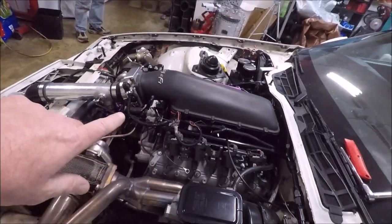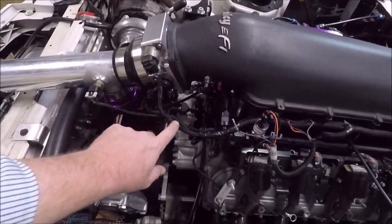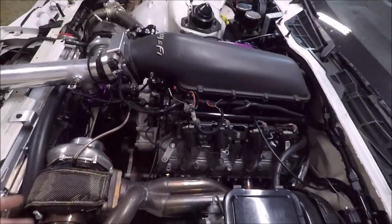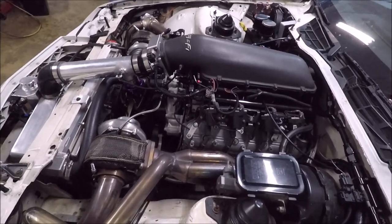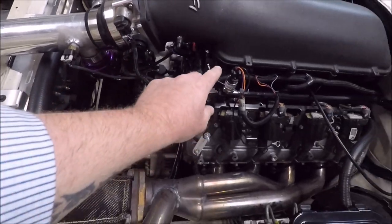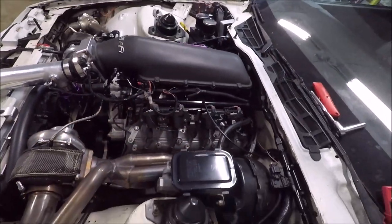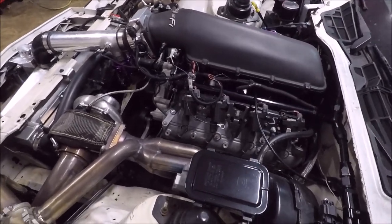So then I got the idea, I looked at the wire diagram for the Holley harness, and all these sensors share a common ground with the fuel pressure sensor. It's pin A18 on the ECU. So what I tried to do was unhook my TPS sensor and ground this through the ground on the TPS sensor to see if maybe something was broke back there. Again, it just reads zero, like there's no ground.